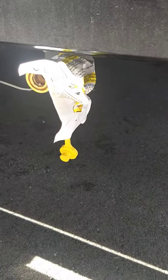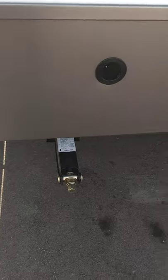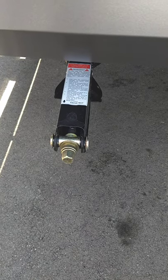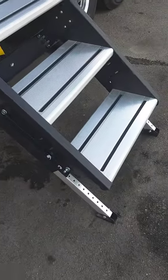There's a quick connect here for LP for a grill or a griddle or whatever low-pressure gas appliance you use back there — that's hooked right to the LP tank. You have scissor-type stabilizers that work with a crank or a three-quarter inch socket on a drill, which is what most people use. You've got a super wide power awning with LED strip.